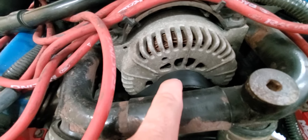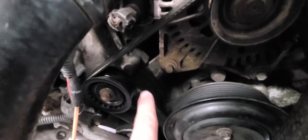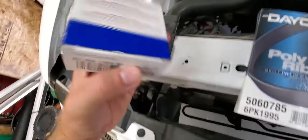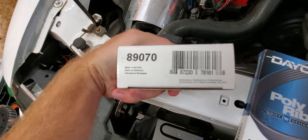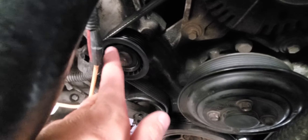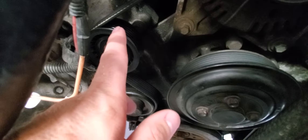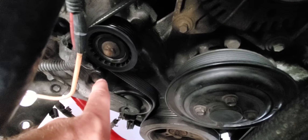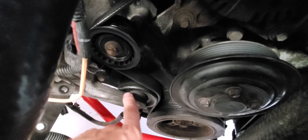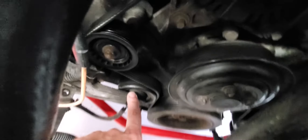I'll show you how I reroute this. The belt goes over the top of the alternator — this belt is a six-rib — comes down to the idler pulley. This is the one that you replace; you got to get the smaller size, which is right here. This is the part number, so look that up. You go around the top — you used to go under the back side of it, now you go around the top — then the back side of the belt goes to the tensioner.